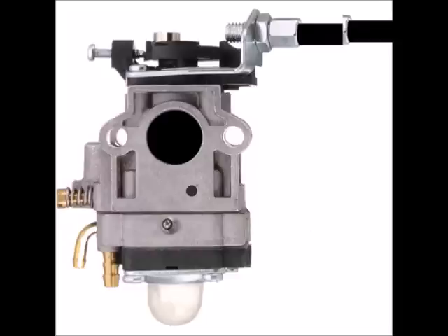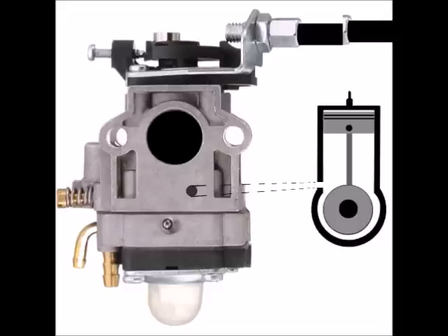To explain how this works, let's come back to the diagram. Imagine the carburetor is bolted to a machine — they're not to scale, I'm just making a point. We've got the connection at the bottom of the engine: that pipe connects to that little hole. So we have a direct connection from that hole to underneath the piston. When the crankshaft turns and the piston lowers, the piston travelling downwards forces pressure through that pipe and into that hole in the carburetor.